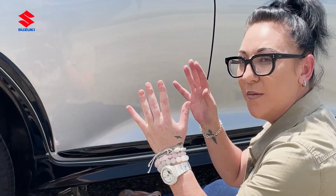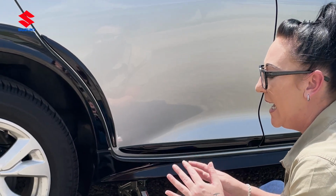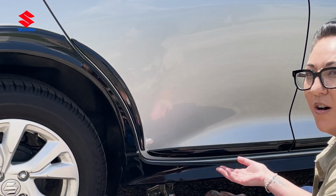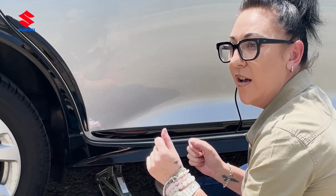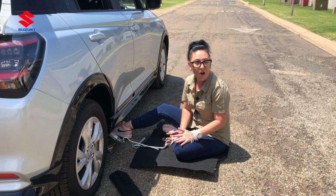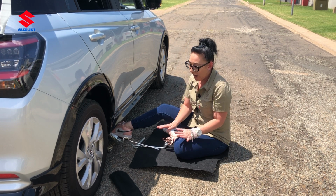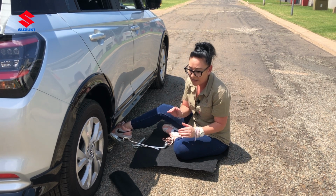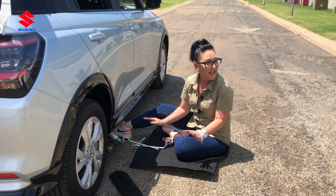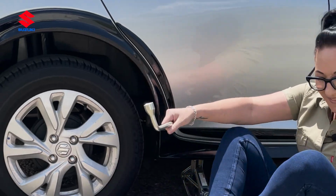make sure before the tire leaves the ground, so it mustn't be mid-air, that we take your spare wheel out and loosen the nuts. You want your spare wheel with you when you've loosened the nuts, so by the time the car is in the air, it's a quick swap over and get the original tire out the way. You don't want any obstacles around you when you're in the road busy changing your tire. So at the moment, my car's tire is still touching the ground slightly, and that is where I'm going to stop jacking up and I'm going to start loosening my bolts.